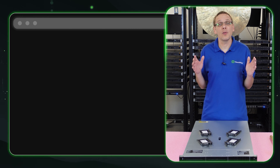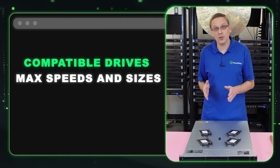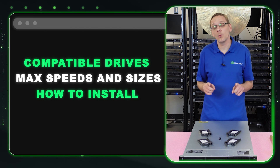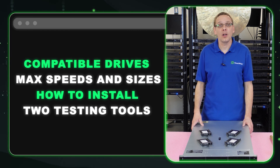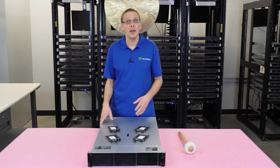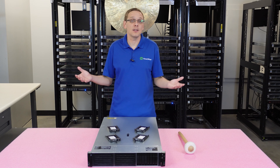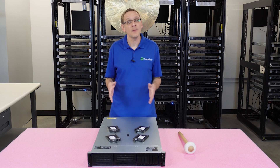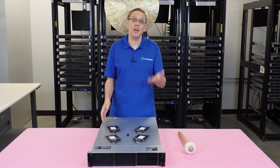Here's what we're going to do in this video. We're going to go over the compatible drives, both hard drives and solid state drives. We're going to show you the max speeds and max sizes. We're going to show you how to physically install them, which is super easy because they're hot plug. And then at the end, we're going to show you two testing tools we like — one from HPE and one called HD Sentinel. With HD Sentinel, we hook it up to a storage array and test drives in bulk, checking health scores and general life, how long it's been running, if it's actually new. It's a secondary tool outside of HPE, and before we ever put drives into a live production environment, it's one of the things we always do.